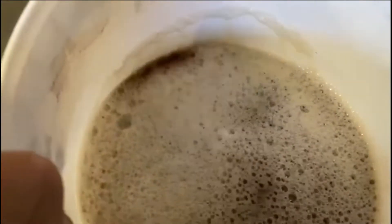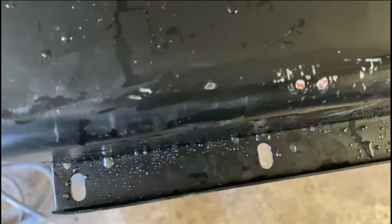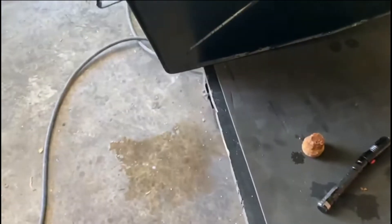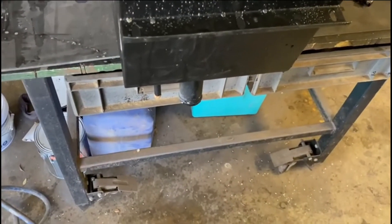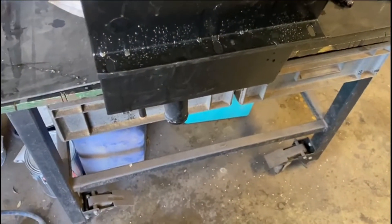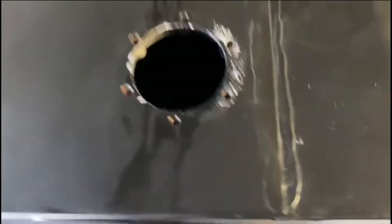I think it's going to work. I've had a quick look inside - all the flaky rust is gone, all that's left is just a little bit of surface rust which will seal over. Now I'm going to let the tank dry for an hour or so upside down on an angle. Then we'll put the rust converter in. I recommend putting a heat gun in there to help it dry. I'll put the rust blast in and let that sit for an hour or so as recommended.